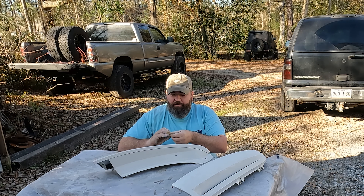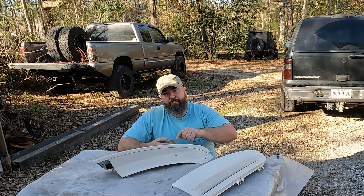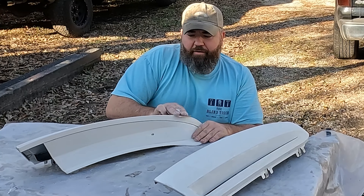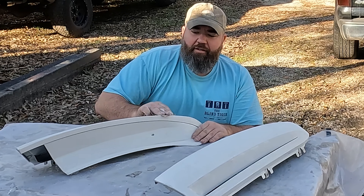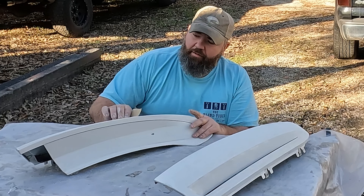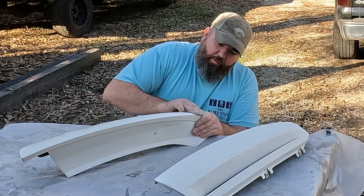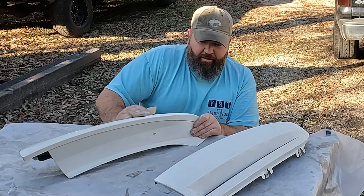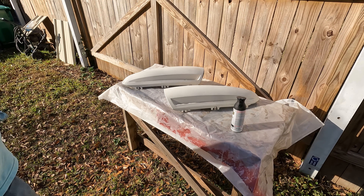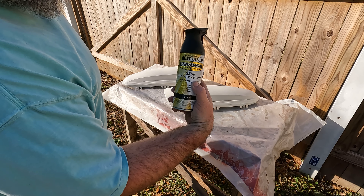It's not a lot of body work that goes into sanding plastic panels — just don't sand through what's there or you'll start seeing scuff marks in the plastic itself. If I had to use an electric hand sander I'd go through this so quick I couldn't control it, but a little hand sanding doesn't hurt nobody. When you're looking to fine-tune, your hands are your best instrument. Alright, got them wiped down — satin paint primer, one coat.